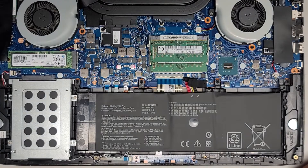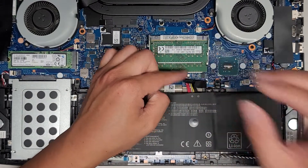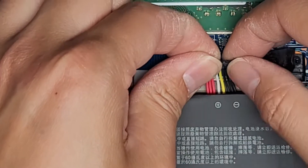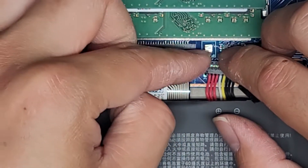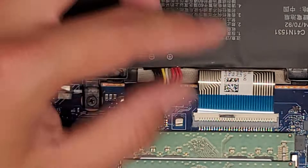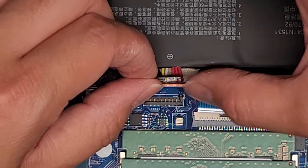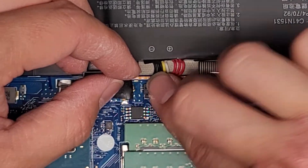The other cable I think was shorter on the original, so we just have to bend it a bit. We're going to kind of fold it up. The connector is down there but the cable is way longer, so we bend this and rotate it to get it into position. These little holes in the connector need to line up with the little raised bits underneath. There's too much slack on this — it's sticking out too much — but I lined it up and pushed it in and there we go. Battery is connected.